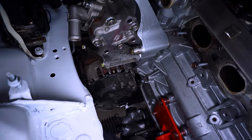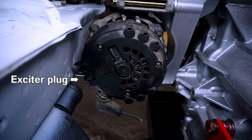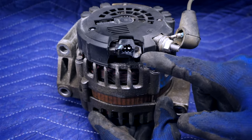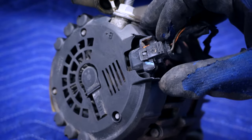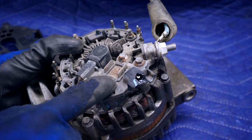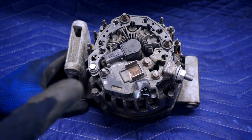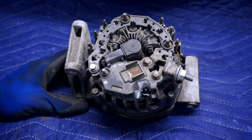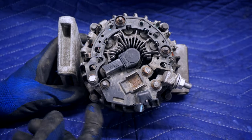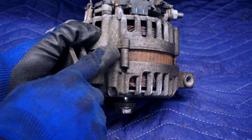Here's our alternator over here on the left side of the motor. Notice that the plug for the exciter is at the seven o'clock position and pointed directly at the frame rail. Here we have the alternator and this is the plug in question — it's absolutely destroyed. The plug is actually part of this voltage regulator. According to my friend Matt, we can clock the alternator 90 degrees so that this plug isn't pointed at the frame rail. To do that we need to remove the pulley, these four housing bolts that hold the two halves together, and then we need to remove this locator peg.